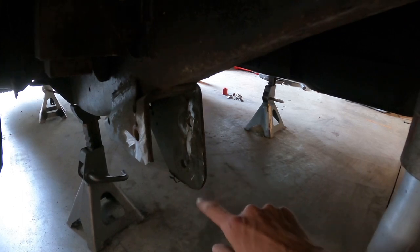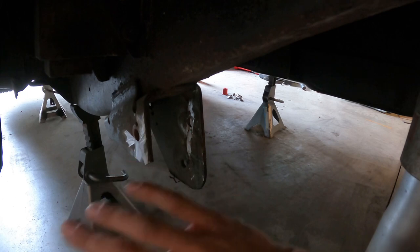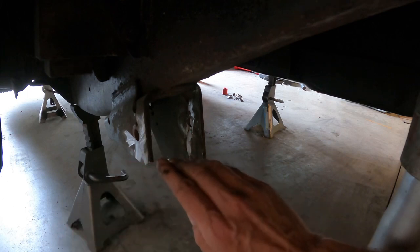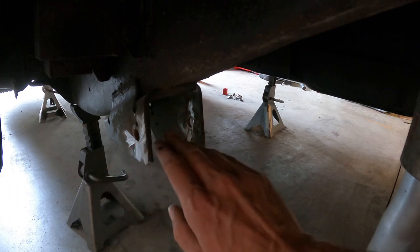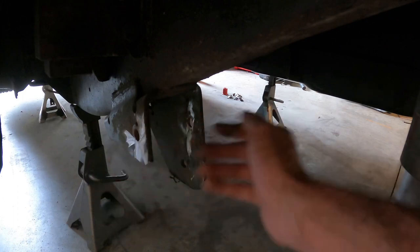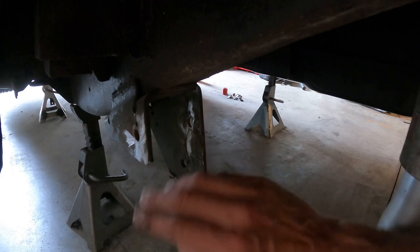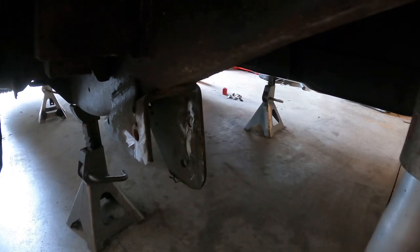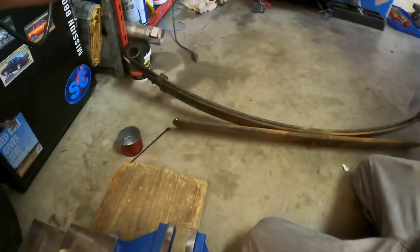I'm going to leave this here so I can hit the inside bends and door sparks. But yeah, it's really a pain. Personally, I'm going to anti-seize everything when putting it back together. This bolt was seized to the collar, so I could pull the nut off, but I could hit it with a big old maul and the bolt wouldn't come out at all. Heat it up with the torch, do whatever I had to do. So I had to cut everything off, bang them out, and then melt them out. And so now we're here at this point. Word of advice, personally, I freeze my bearings.